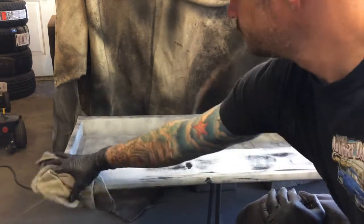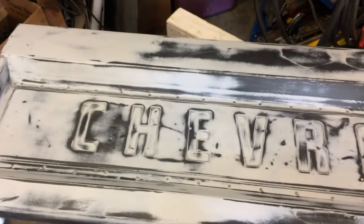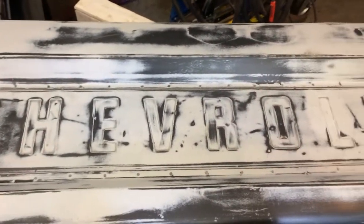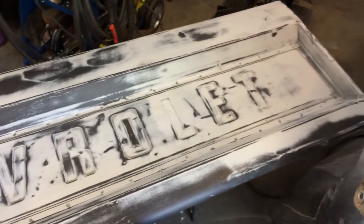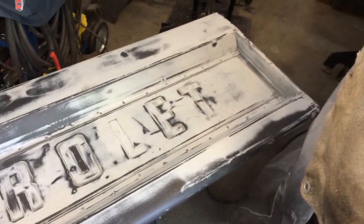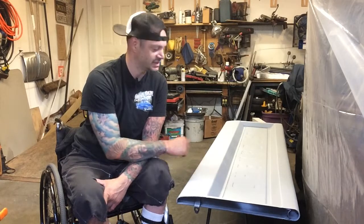If you sand off the guide coat, but you notice there's still some guide coat on there in certain spots, that means that's a low spot. You obviously don't really want to get all the way back down to bare metal. The black epoxy primer underneath this gray will kind of indicate that's probably as far as you should be sanding for that.